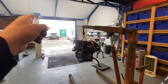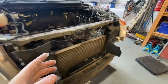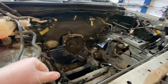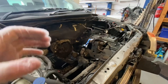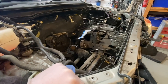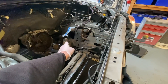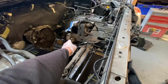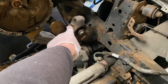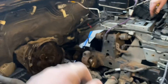As the truck's in and the engine's sitting there, we've greased up the dowels. I've got a jack under the bell housing and the gearbox just to give us half a chance. It is difficult — this initial bit of getting it in there and clipping it up to the bell housing is going to be the hard part, so we're probably going to be a little bit silent for a minute just while we get it all lined up. We've decided to remove that engine mount and actually fit it to the vehicle first, because that was a nightmare to get off while on the car — that bolt is the one we snapped a Snap-on impact socket trying to undo.